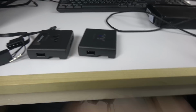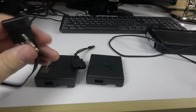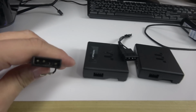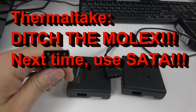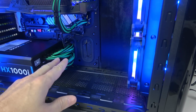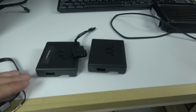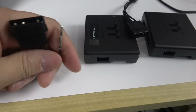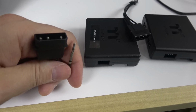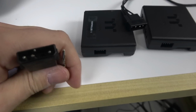The problem that I had and that you need to check is that my control was not working. I looked at all my Molex, and Molex has a tendency of doing that. When you put the Molex together, you push against the power because you've got power coming out of there. I've got a Molex with 3 Molex coming out of there, so I connect all my controllers to it. But when you push it, the pin pushes out, so the connection was not made, so it couldn't see some of my controllers. So I had to recheck all my Molex connections. So be careful when you do that. It might be a cause of your problems.